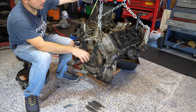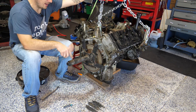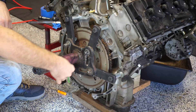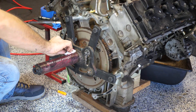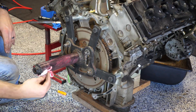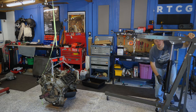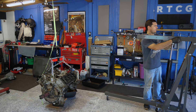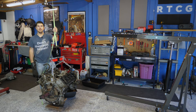Now that this is connected, we're just going to take our engine hoist, transfer it over, lift it up, and then we just need to put this one peg into that one hole. I'm going to grab some chassis lube and lube this up just to make it easier to go in. This will help it go in a little bit easier, but also when we rotate the engine in the mount, this will definitely help that process as well, especially since I'm doing it alone.